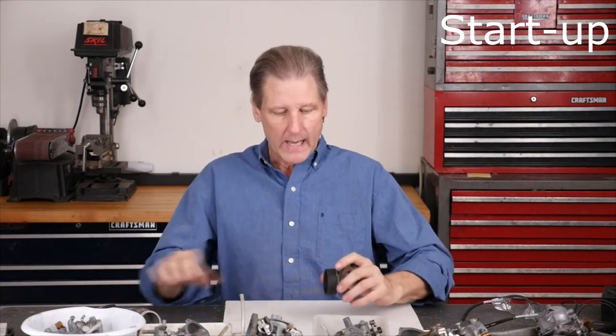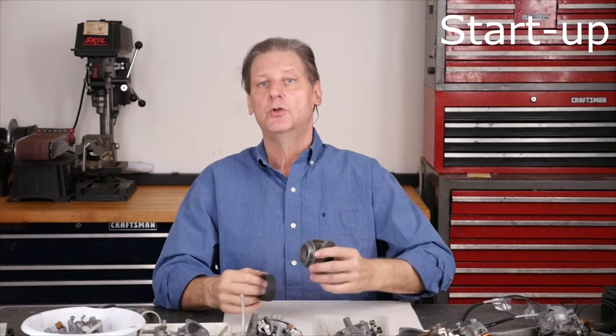None of those problems with the S&S style. They make them for the early O-ring style too. And of course, if you do have this '79 and later rubber band abomination, you have to have that support strap that goes down from the air filter to the number three lifter block. Because there's no amount of reefing even with S&S clamps where the weight of the carb isn't going to loosen this up, crack it, and you blow a hole in the piston — front cylinders run hotter.